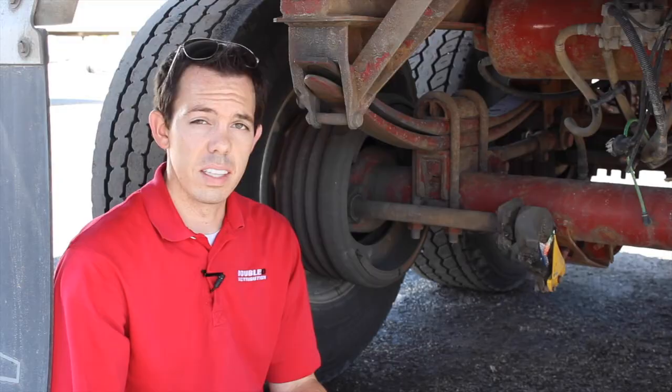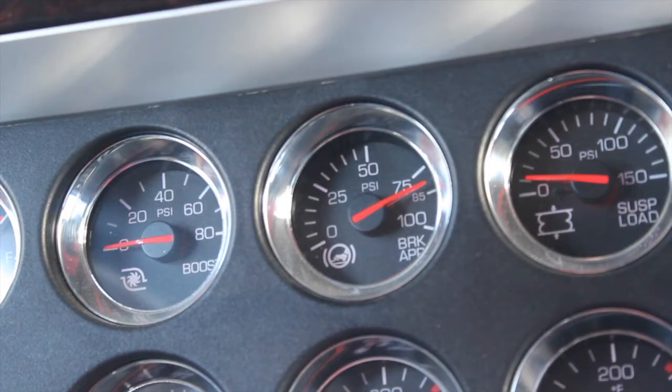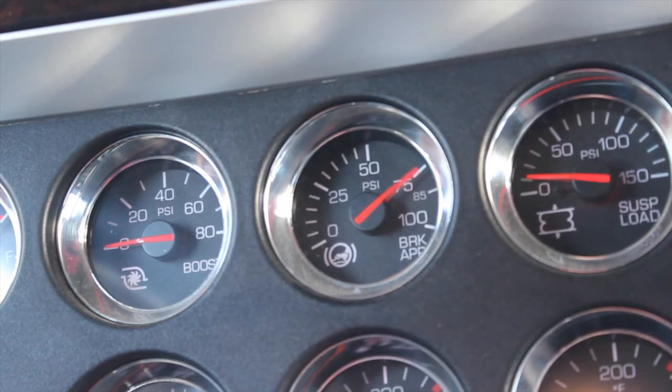The last thing you need to do to check your brakes happens inside the cab. Because we have automatic slack adjusters, the way you make sure those are working is through brake pressure. So before you leave the yard each day, you need to get up on your brakes and apply them really hard — like 100 PSI — and pump those four or five times. Now doing this may drain your air down on your air tanks, and you may need to build them back up, but it's worth the effort because that's how you'll make sure your brakes are in the right spot.